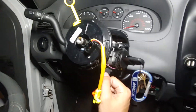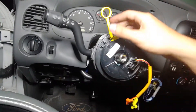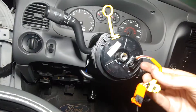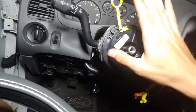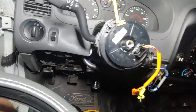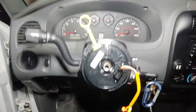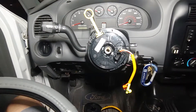I'm not sure when to pull the pin — I think I'll do it once I route the connectors through the steering wheel, because then I know the steering wheel is straight on the spindle and I don't have to worry about the clock spring rotating anymore. That's my next step, and everything else should be the same thing in reverse. Thanks for watching.